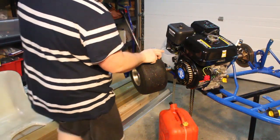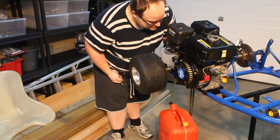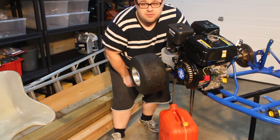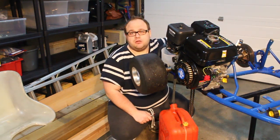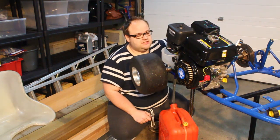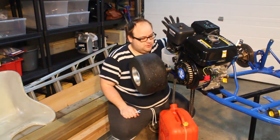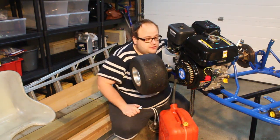I've got my fancy funnel here. I've also put on a glove because this invariably is going to result in a fuel mess everywhere. I've got the funnel hose going into a jerry can. The valve on the back of my funnel is open, and now I'm just going to undo the bolt on the bottom of the float bowl — that should drain it at least up to the level of the pickup in the tank. One convenient thing is there's a filter in the bottom of this funnel, so I can just undo the bolt, let it drop, and retrieve it later after it's all drained out.